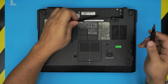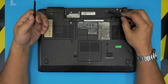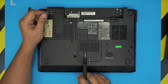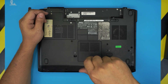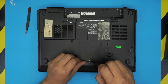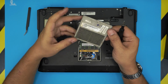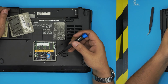You're going to be using a Phillips number one. Make sure the power is off for the laptop and remove the battery. Now we're going to start removing this service cover right in the middle, which is marked 'M' for memory. Remove this screw right here — it has a C-lock on it so it will not come out; you only have to loosen it up a few turns and then simply lift up the cover.